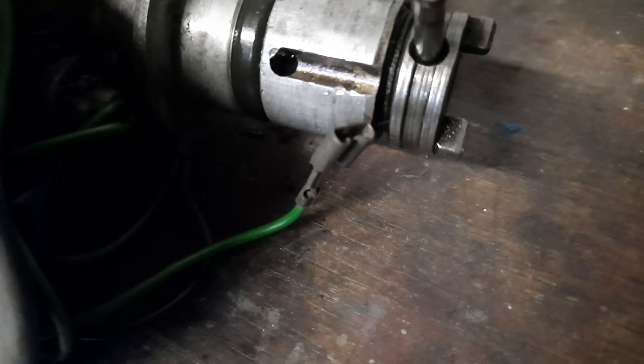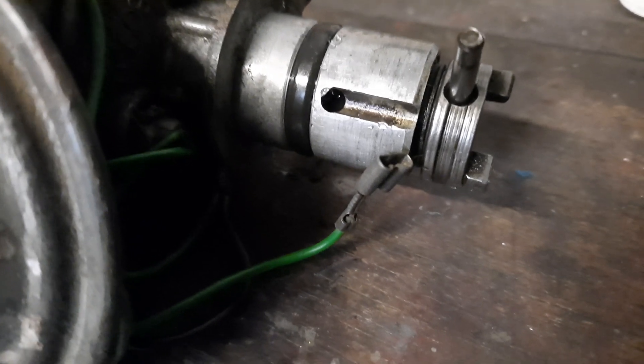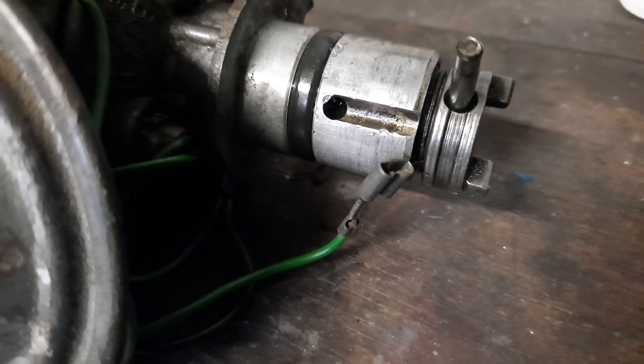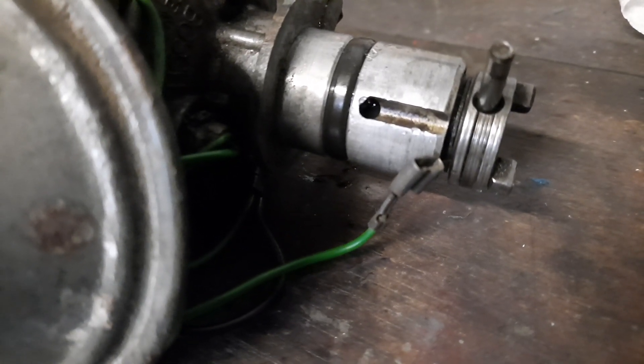The spring adds to that and they haven't even got the right spring. My theory is that the distributor drive shaft was moving up and down, and when it does that it's altering your timing — because it comes up at an angle on the spline. If you ever pull one out and put it back in, you've got to turn it as you push it in. So if it's moving up and down it's altering the timing. I was also concerned that it's barely engaging the gear anymore — if it wears any more it might pop right out altogether.